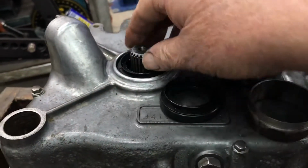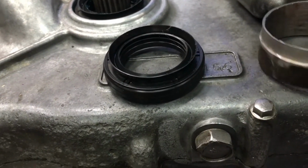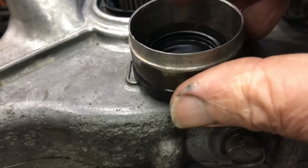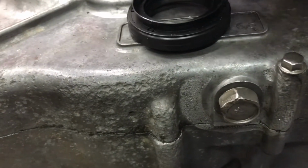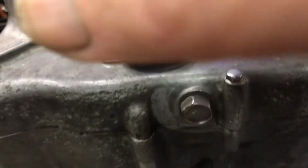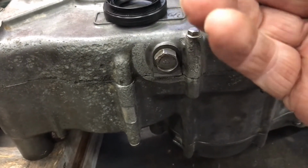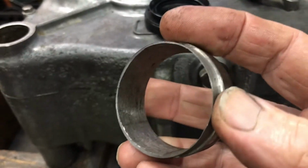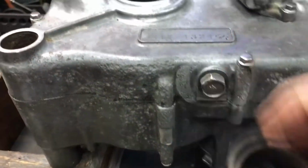Okay, that's the seal fitted there. The seal needs to be pushed in by something fairly thin wall. That there was close. It goes around the lip in the middle, but was a bit tighter fit. It wasn't actually pushing down inside there, and it needs to go down inside there. So I turned an edge off that, so that I used that to press it in. It's a shitty bit of old pipe or something. Ended up made it a bit too thin, but it worked. It didn't take much pressure at all. So I'll push one in the other side.